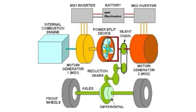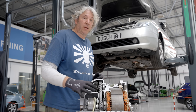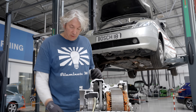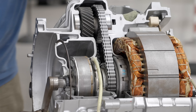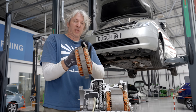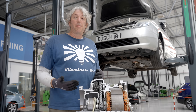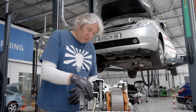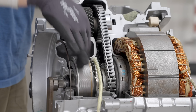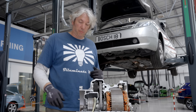In the case of the Prius, it's called a power split device and it's actually a planetary gear set just deep inside this assembly here. The Prius actually has two electric motors and the internal combustion engine. You've got motor generator one — the windings on the outside are the stator, and that's the rotor. One of the interesting things about a hybrid is they normally don't have alternators or starter motors — they actually use one of these motors. So if it were to spin up motor generator one, you can see that the crank handle starts to spin around — that's actually going to be starting up the internal combustion engine.